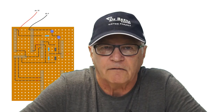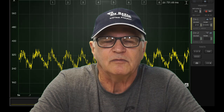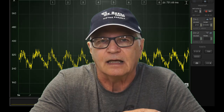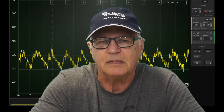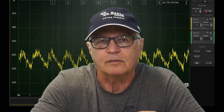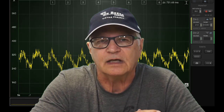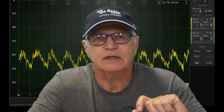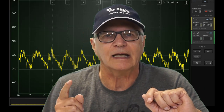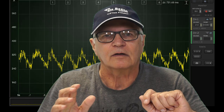I stated in the demo that this was a very targeted oscilloscope circuit. Here's a look at a typical relative compression waveform — it looks noisy, but it actually isn't noise in the pure definition of it. What's actually happening is that two tests are overlapping: we have the relative compression test that we mean to do, but there is also an overriding commutator test being performed on the starter armature — very much like the fuel pump commutator test. For every compression stroke encountered, there are hundreds of small segments riding up and down the peaks and valleys of the waveform.